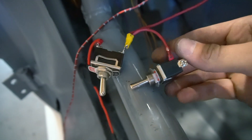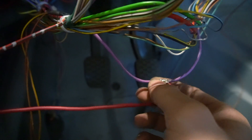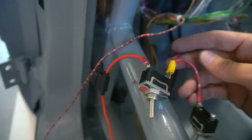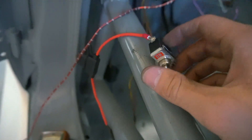Here are the switches for my fan and my fuel pump. So I went through to the ignition and found which one was key-on accessories — that's this purple wire right here. When I found out that purple wire was key-on accessories, I pulled back some of the wiring and spliced it off, then soldered in another line which goes to the jumper from my 12-volts to my switches. But with the key off, the switches will not work, so I get nothing from the switch.